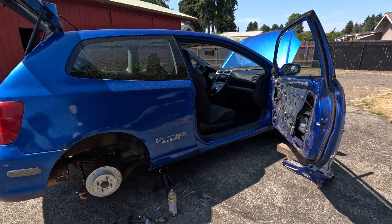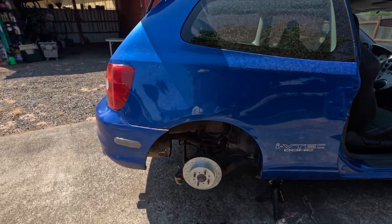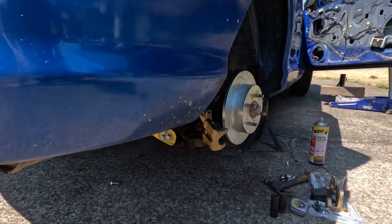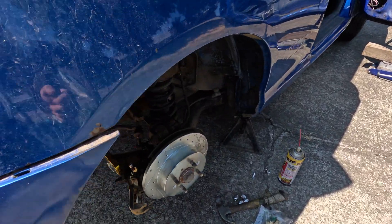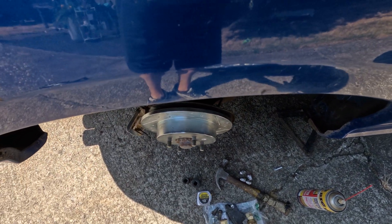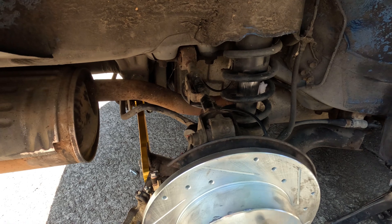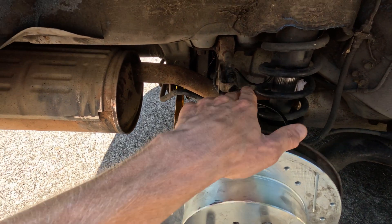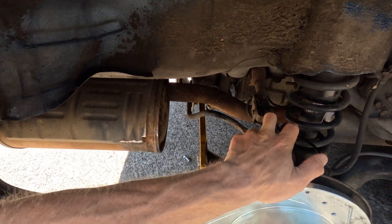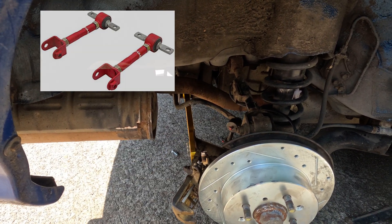Quick glimpse of my car — it looks like the previous owner hit something here. If you've been watching my previous videos, I went ahead and replaced the rear trailing arms because the right side was broken. Upon inspection, placing the tire back on the rotor, I noticed the toe was toeing out. The first thing you want to check if your toe is off is whether you have any bent parts — this right here could potentially be bent. This also controls your camber, so they do make a camber kit that runs about a hundred bucks for these cars; I'll drop a link below.